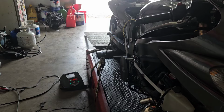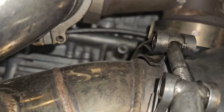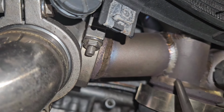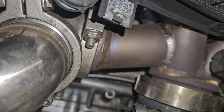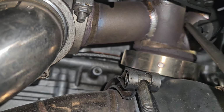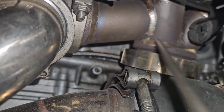I'll show y'all what I'm talking about here. Let me, and where's my flash? There we go. What I'm talking about here, about the hard 90 thing. This is James Carroll's exhaust flow. Comes down here. This runner over here is not merged into that. That one isn't, and the one in the back isn't. It's literally just pulling this one runner, and it's a hard 90.